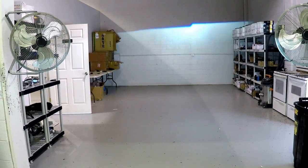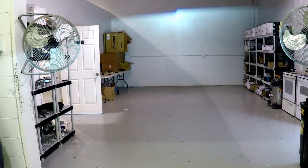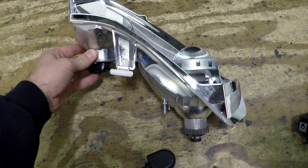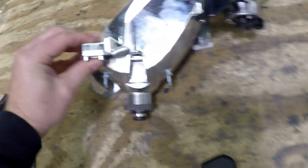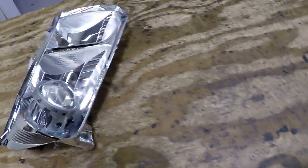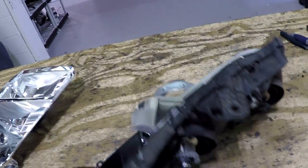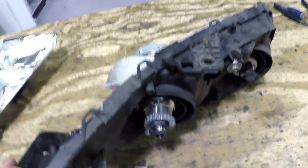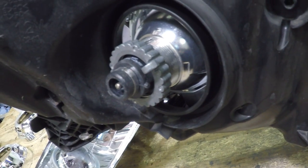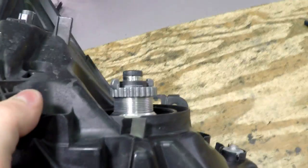That covers the up/down and rotation. The last thing is the left and right. You can eyeball it — the car is on-site here. It's a little difficult to gauge left and right, but you can make reference points. You can see a nice vertical line right there in the reflector and the body. It looks like we've got the right position, but the best way to finalize it is to put it back in the car and do a car test — we'll do that shortly, not in this video.